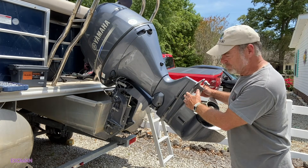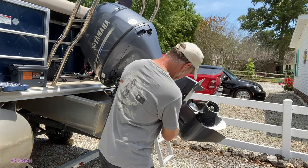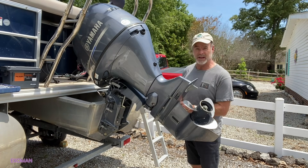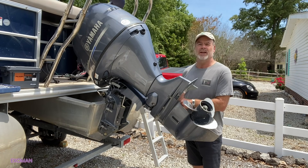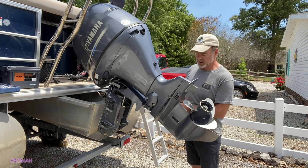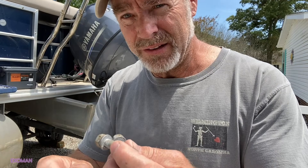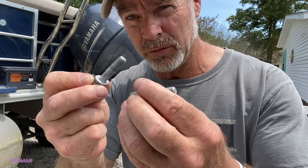I'm going to take this part off — there are three bolts here and three on the other side, let's get those out. Some people say I'm cheap, but what I am is thrifty. Money saved is money earned. As I always say, hire a pro when you can afford it, because those guys are going to do it right versus you possibly making a very expensive mistake. Now I've removed the six bolts with washers — when you put these back in, put a little marine-grade grease on them so they don't freeze.